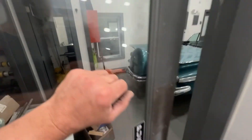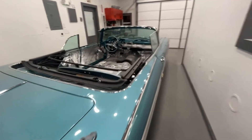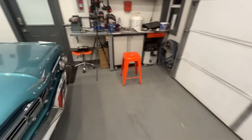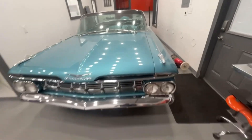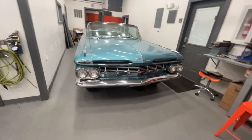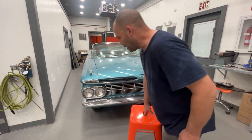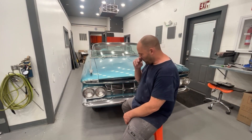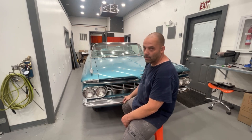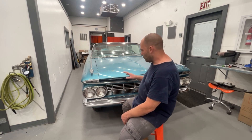Fingers crossed, the parts for the 59 Impala should finally be on their way from California — the last couple parts I'm waiting on. I'll do a couple more videos getting it buffed out and cleaned up before sending it down the road to the interior shop. I'm also waiting on upper moldings; the ones I have were re-chromed but they bubbled, meaning they didn't get all the rust off, so I'm not putting a re-chromed piece with bubbles under the chrome on the car.